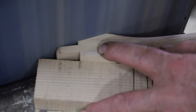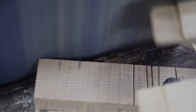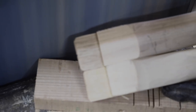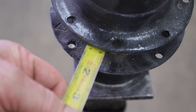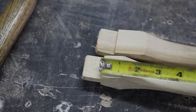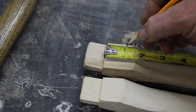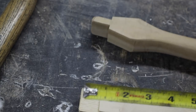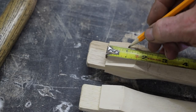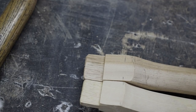But in the process of doing this, you'll see that the length of the face of the wedge becomes longer as compared to the face of the inch and a quarter. Well, the flange depth from the core to the edge of the flange is still in that 1 inch area, the same as the first two hubs. So now I have to take and re-throat these spokes so that they are down to the same position of the inch and a quarter. So where I had just a little adjustment to do on the inch and a quarters, now I have a lot of adjustments to do to make these inch and 3/8 spokes fit the exact same flange as the inch and a quarter.